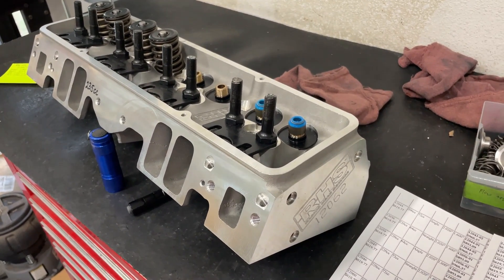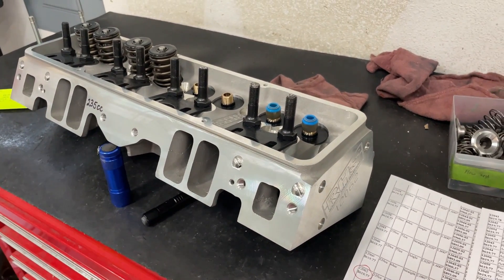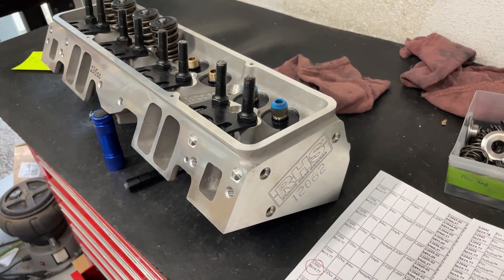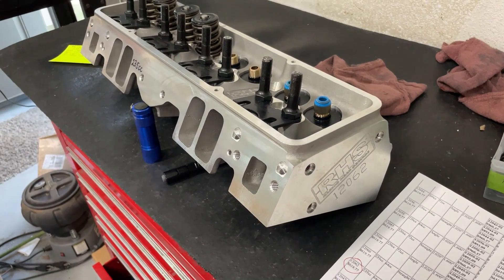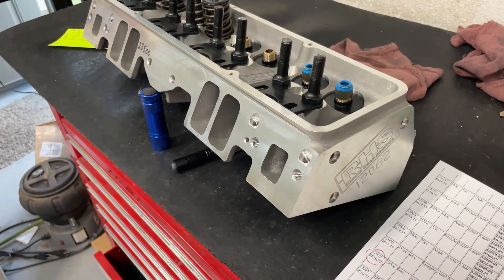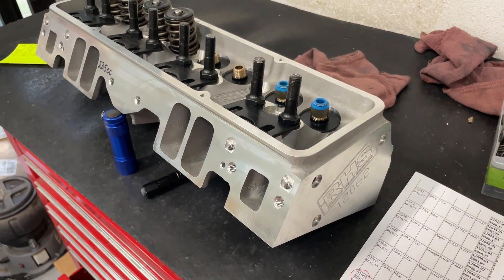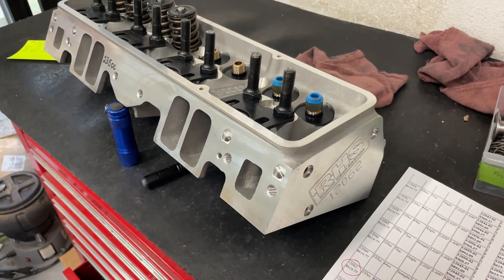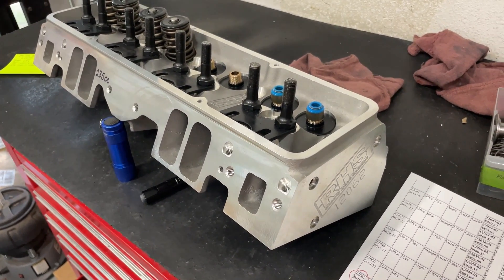Pro Top Line developed this head. To be quite honest, it was pretty good, especially when it came out. They offered it in aluminum and also in cast iron. For those in the circle track world, at the time there were really only three cast iron heads available for circle track guys, because they're not allowed to run aluminum in most classes. You had the RHS, you had the Dart Iron Eagle, and then you had the EQ. The RHS in my opinion was better than most of them. The EQ kind of caught up because they made a revision. The Iron Eagles were really good too, but they were way more expensive than both EQ and RHS.